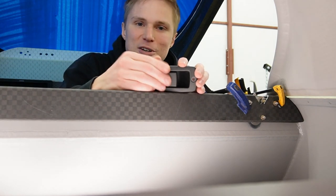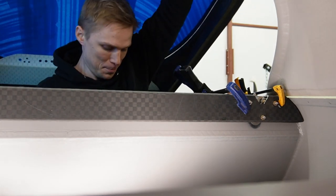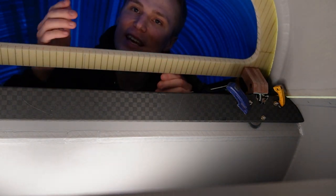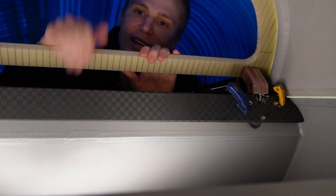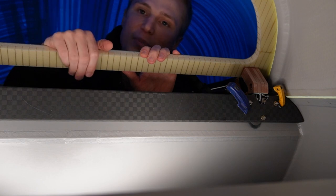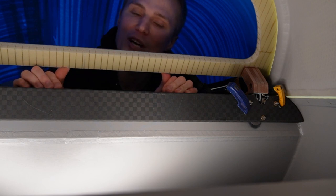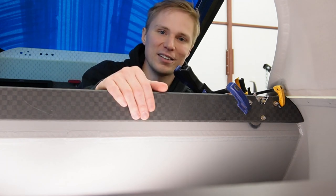Let me demonstrate the close and open action. Coming down with the canopy, you can see the hook and latch engage — so just by closing the canopy, we get automatic engagement of the latch system. This is nice because there isn't a secondary step you have to remember in order to secure the canopy before takeoff. To open, we simply engage with the aluminum tube and push up on the canopy, just like that. There are a few small tweaks we'll be making, but overall we're very pleased with how everything engages and latches up.